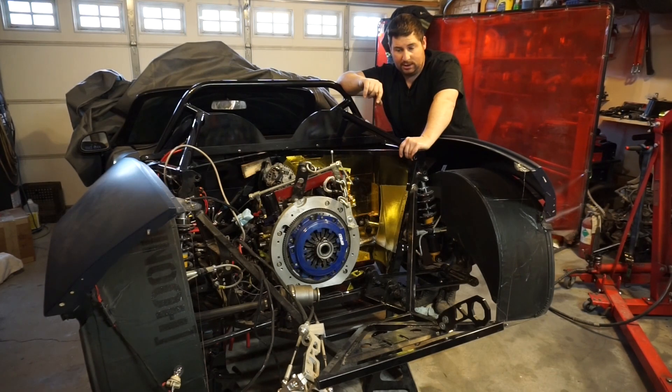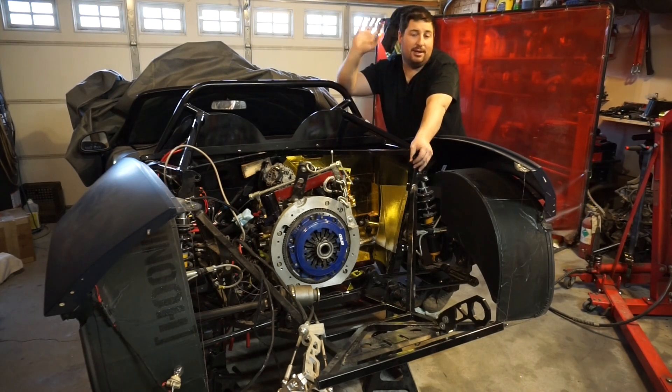The axles aren't going to cut it — they could work but right now they're the weak point, more so than the five-speed. So before I bother putting the six-speed in, I want to run the six-speed axles. I've got to upgrade hubs, and then I might as well upgrade brakes — it just doesn't end with this car. The priority now is to get a transmission bolted to this, turn the car around, bolt an exhaust on, and make sure she braps and has compression. Then I'll feel a lot better about finishing the little things knowing the engine is probably good. Thanks for watching — I know this video was a little all over the place, just kind of how I've been working on this car. But now it's more linear to the finish. Thanks for watching, until next time, peace.